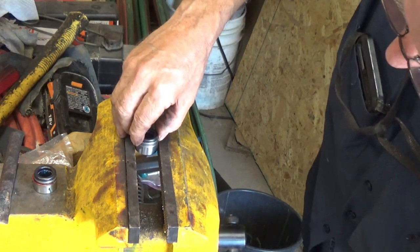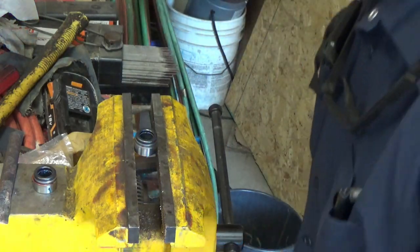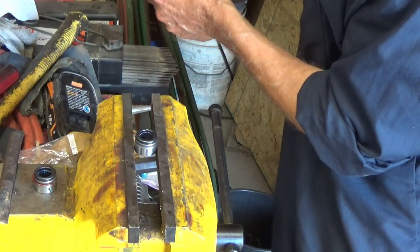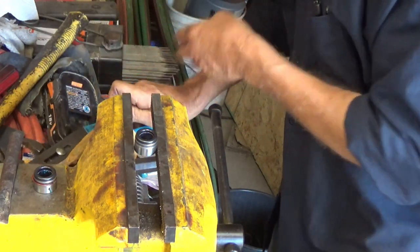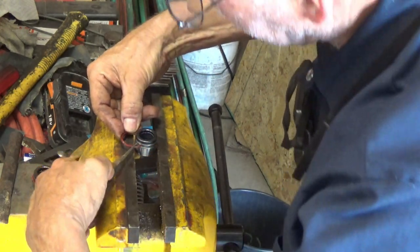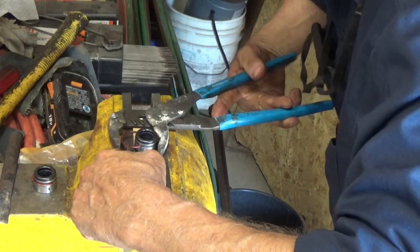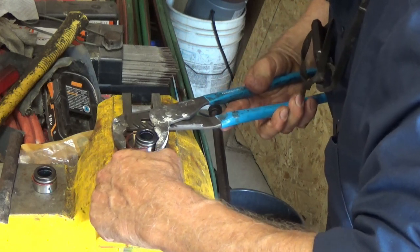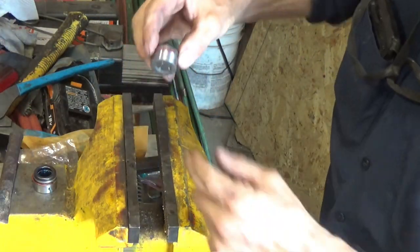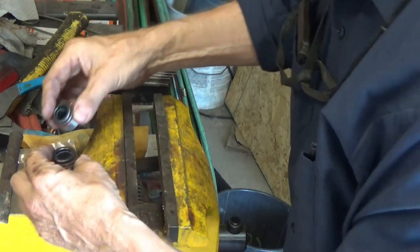These last two caps don't get pressed in — they just go in the differential yoke and there are a couple of clamps that go on top of them. So what I'm doing here is squeezing these in, putting it in the vise, hanging on to it with miniature pliers, and then grabbing the bigger pliers to squeeze that on. The clamps will go on the outside of those, and those go on the u-joint. Put the clamps on — we're done.